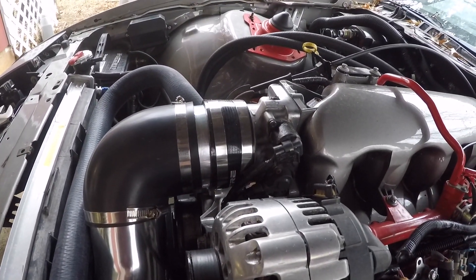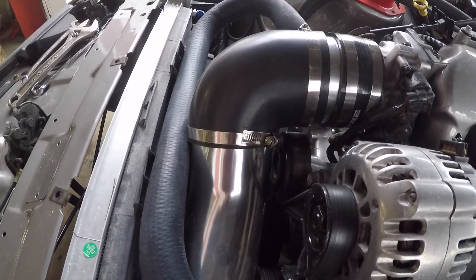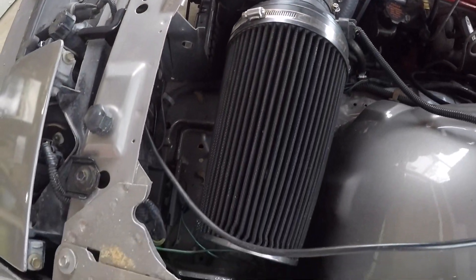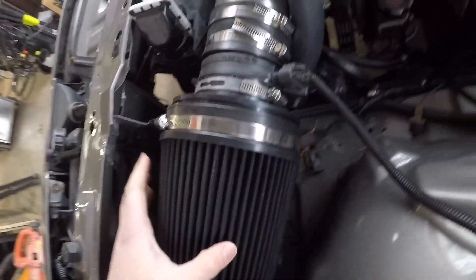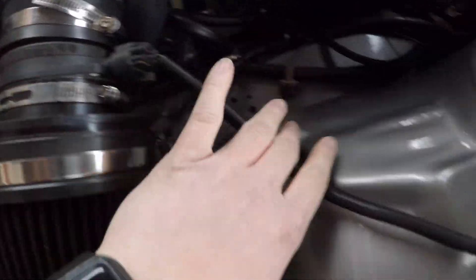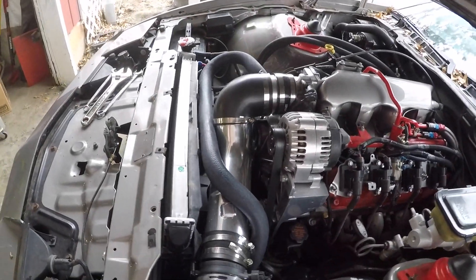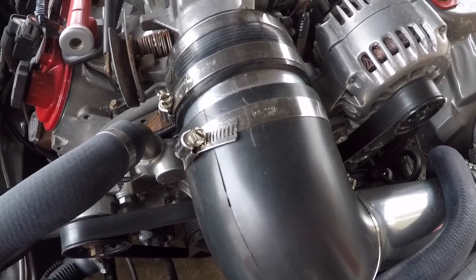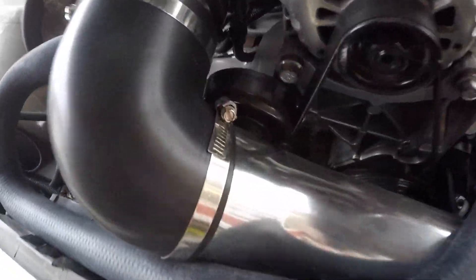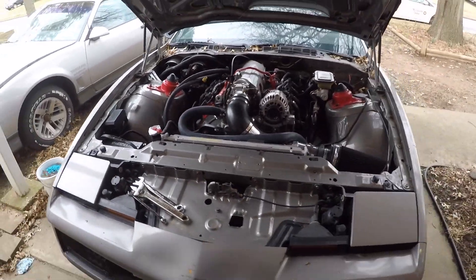All in, you're looking at maybe $60 plus tax — not too bad. This setup is definitely not permanent. Eventually I want to actually make a proper cold air intake that routes down through the battery tray. The stock filter came with the kit, and the mass airflow sensor is right there. I still haven't routed that permanently, but there's plenty of slack. The spacer was needed to clear the idler pulley.